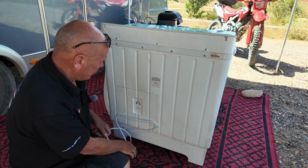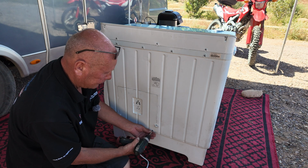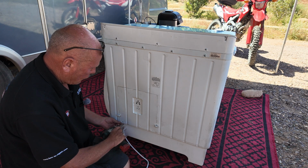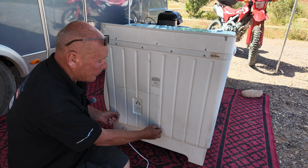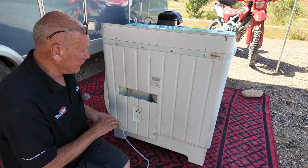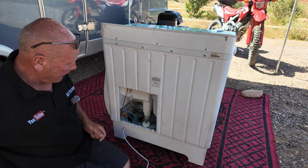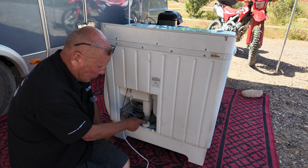So removing the lead, you will find 3 screws. Remove these and make sure you keep all the screws in order as you dismantle the machine. The reason being, the threads on the screws will vary throughout the machine. Slide the plate down and then it will just unclip. This then exposes the pump switching gear.